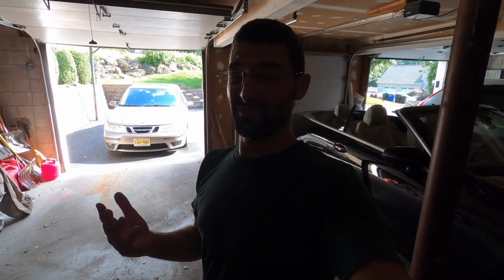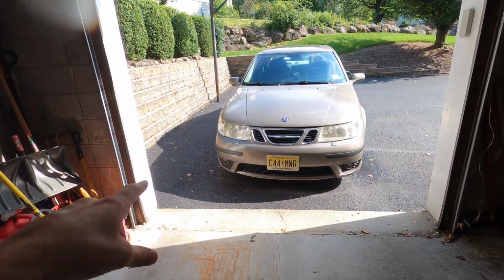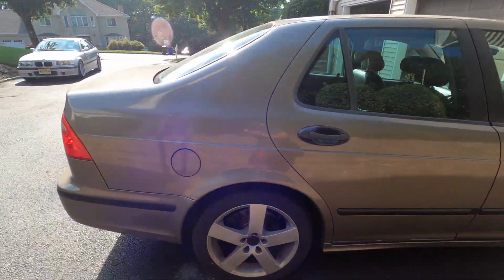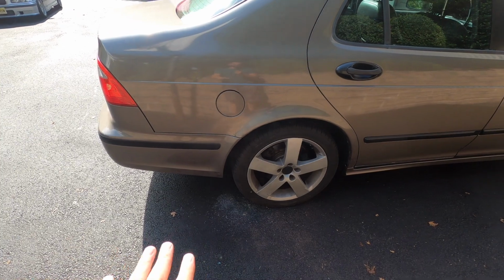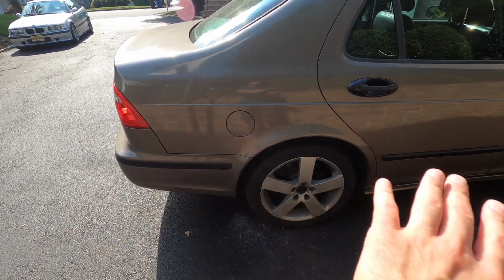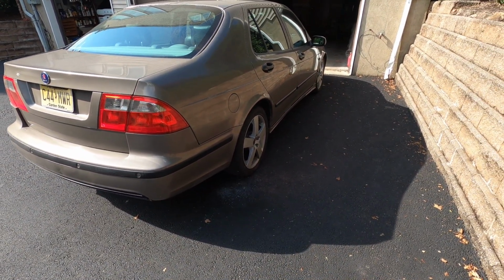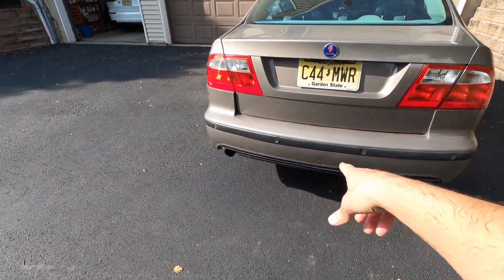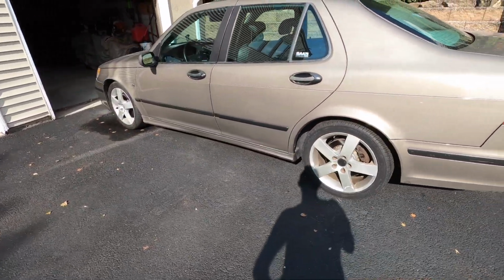All right guys, it is like day 3 or 4. I didn't film everything just because it's a little bit monotonous after a while, but if you guys look, I kind of did a quick repair job on the front bumper with all the scrapes, and I'm not finished with the painting, but we successfully fixed up this little patch area here. It's not that perfect right now, but like I said, I'm not done with it. I ran out of paint, but we're gonna end up sanding this down and blending it in a little bit better. But for now, at least, we don't have a rust hole any longer in this fender, and with the POR 15 it should stop rusting. I removed some of the dent on that bumper, which we'll fix up eventually as well, and over here everything's back together as well on this side.